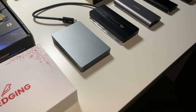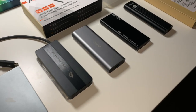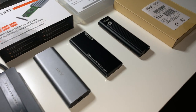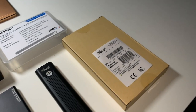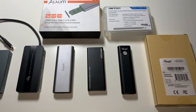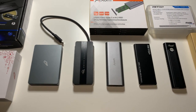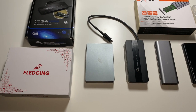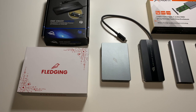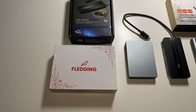In summary, if you are buying a USB enclosure, there is not a lot of difference in speed, and a slower M.2 drive will do fine. Thunderbolt technology allows the drive to run at faster speeds — the OWC Envoy with Thunderbolt 3 was 1.5 times faster than USB. But if you want speed, I find the Fledging Shell Thunder was 2.5 times faster than an M.2 USB enclosure. Thank you for watching.